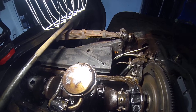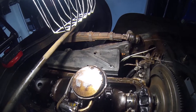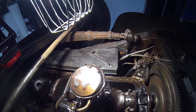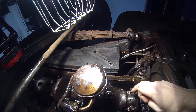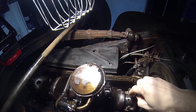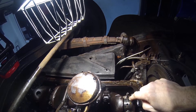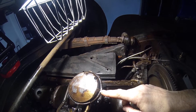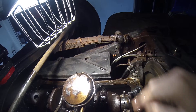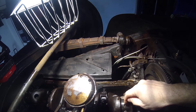I laid the bearing cap down on a shop towel beside me — it's good to have paper towels nearby. Worth mentioning: there's a layer of oil here. The oil pump pushes oil through the galleries; it comes out that hole right in the center of the crankshaft, which is rifle-drilled. Oil flows through it, gets into the bearing, and it spins. When you shut your engine off, that thin layer of oil sits between the bearing cap and the crankshaft. You need that oil there for when you start your engine, especially in cold weather. It can take a while for the oil pump to pick up thick cold oil. So it's important to let your engine slowly idle when cold — if you blip the throttle you will likely cause damage as this area is starved for oil.